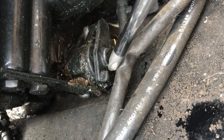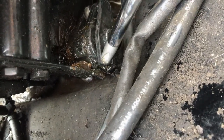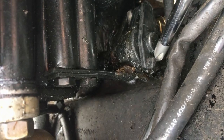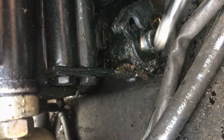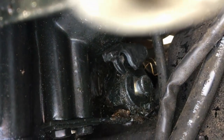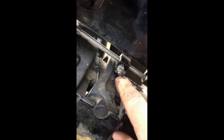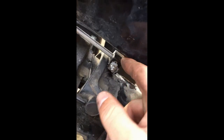When removing the lower unit shift linkage, on the tiller handle side, there's a little clip down here. Pop this clip up with a screwdriver. Now it's popped up and you can just reach in — this slides out towards us, so you grab it and pull it out. Then the shift linkage is ready to remove. After you move that piece up top, come down here and get an 8 millimeter onto the shift linkage going down into the lower unit. Undo this almost all the way — I don't take it off the bolt, I leave the nut on the bolt, and then this piece will just slide out.